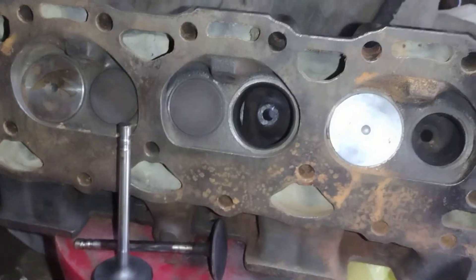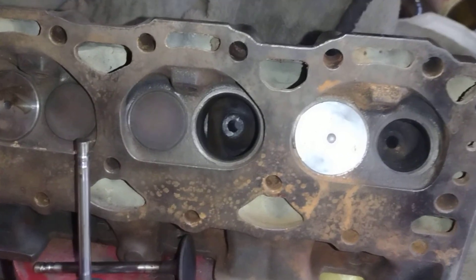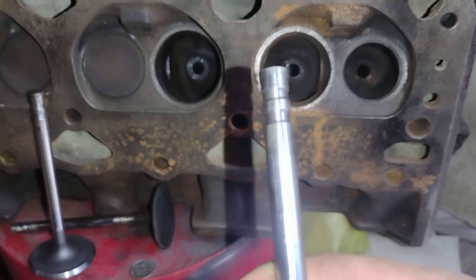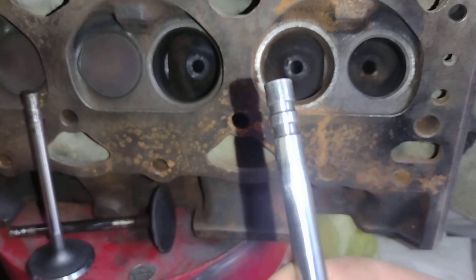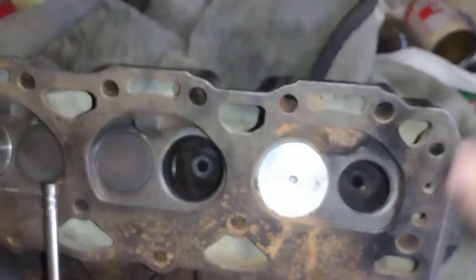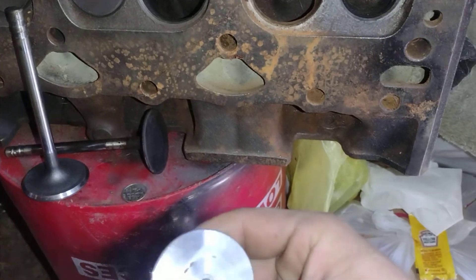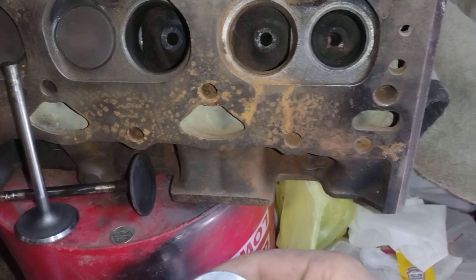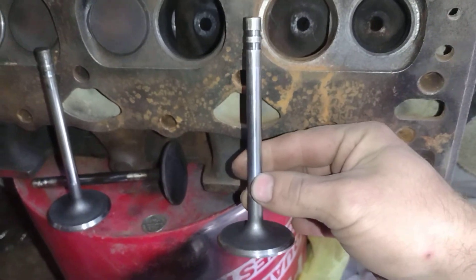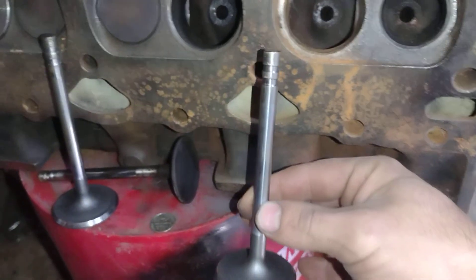There were too many issues with the original valves and I wanted to make everything better — take it to the next level. It took about two weeks of research and I finally found these — they are 1393s, sealed power. I finally bought all the intake valves. They were not an issue to find. They are 11/32nds standard size valve stem diameter, 4.9280 inches in length. Every time you look online they always take a picture of the stem showing the two grooves and that's it — no picture of the face.